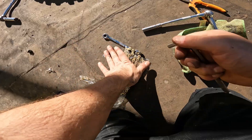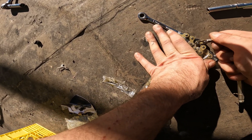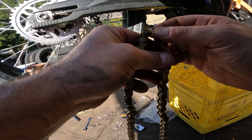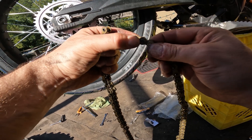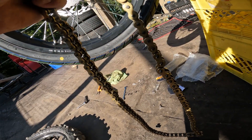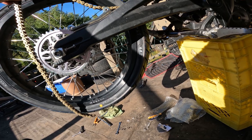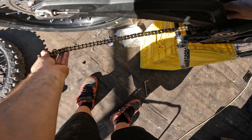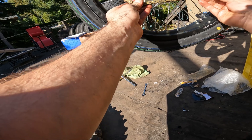First look. What I did last time can be done again — maybe not, maybe this one's too hectic, it's brand new. There we go, got it off. There are two o-rings and then you got this piece here, and there's going to be another o-ring here. What you might want to do is take this piece away and put it with all your other stuff. When you're trying to fish it through where it's supposed to go, get yourself some slack over here. This is going to be the hardest part — trying to get this chain around that sprocket. It's easier than trying to pull the engine. You can see right now that I'm a couple links off of where I would like to be.